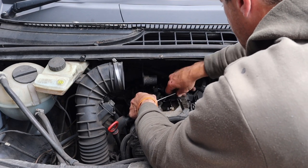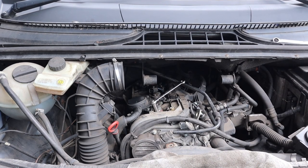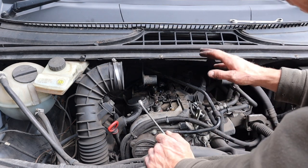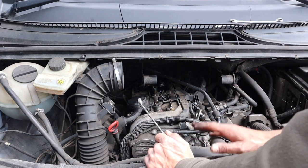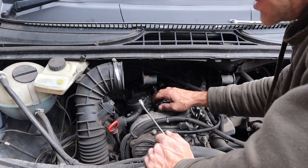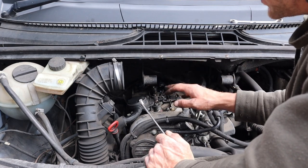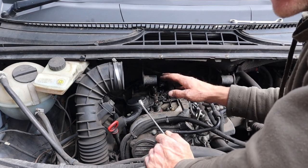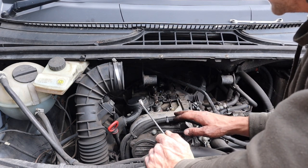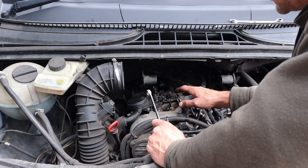All four bolts out — wasn't too hard. Before you take your injectors out, if you're going to take them all out in one go, they need to go back in the same hole. Each injector has a code on the top, and if you swap them over you need to recode the injectors. That's a pain if you haven't got a diagnostic computer. All the flow rates are different on each injector.